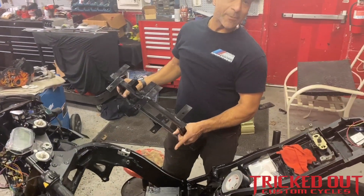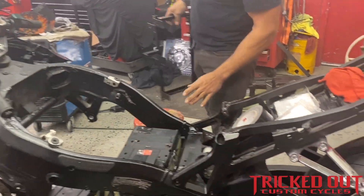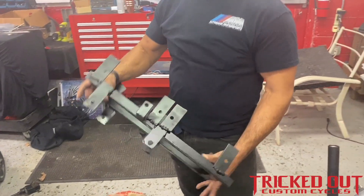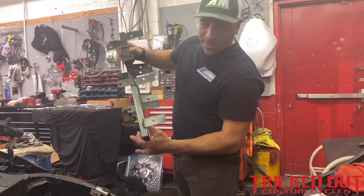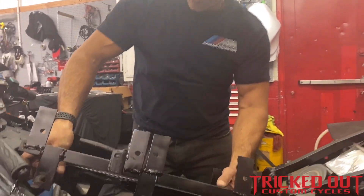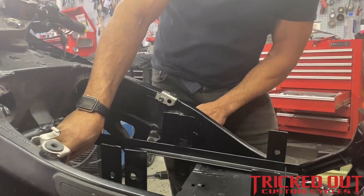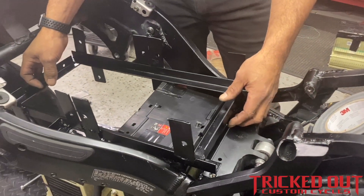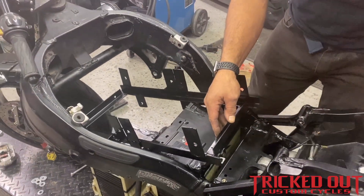I made two separate battery trays. The bottom one holds one battery in place, and then the top bracketry holds two and hangs one. That little flip-flop of the batteries helps get the correct clearance to hold the controller mounted to the front of it. I made this through the existing engine mount hole on the left and right side of the frame, basically transmitting the weight of the bike exactly the way the engine would if there were a regular gas engine in there.